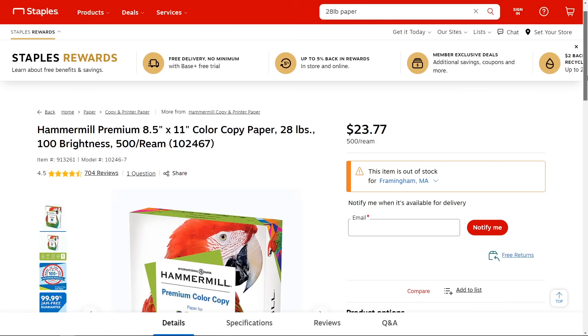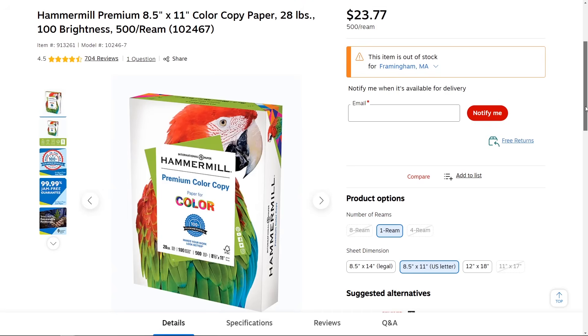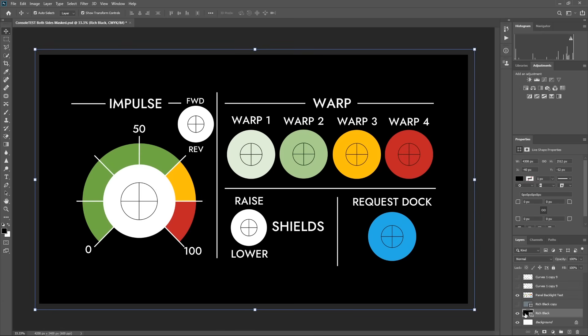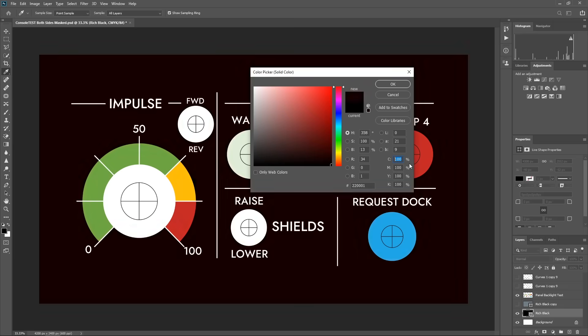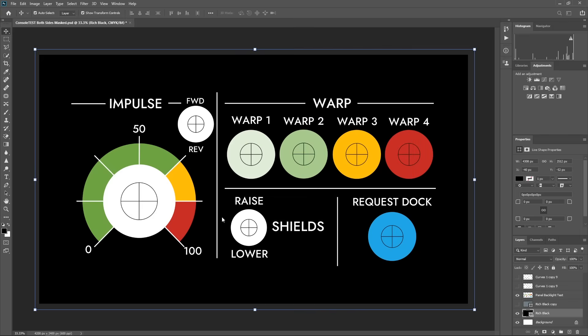So how can we make this better? Number one, we need to use better paper — find some 28-pound or 32-pound paper from an office supply store. At a copy center they might sell you a couple of sheets for just a few cents. Next, we're going to want to turn up the black portion of the design — the bottom layer in something like Photoshop — to 100% CMYK black: 100% cyan, 100% magenta, 100% yellow, 100% black. This is not something you'd ordinarily do in a commercial printing process — you can get a better-looking rich black using different combinations — but here we're just trying to get the printer to put every bit of toner onto the page. Try printing with 100% CMYK black and it will probably be a big improvement.